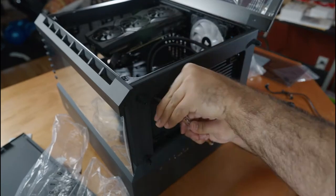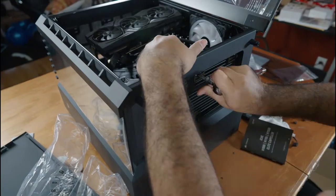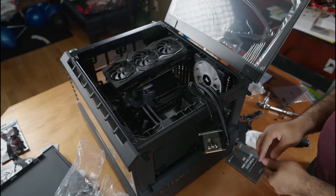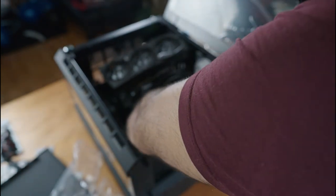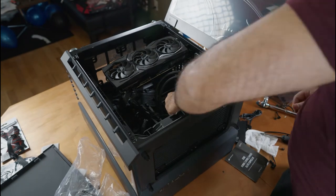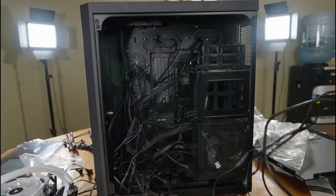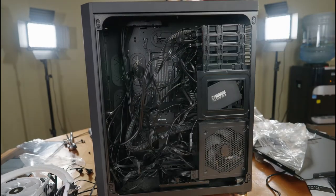Now we have to install the radiator in the case, and as I mentioned, the screws were insanely hard to drive in — it took a lot of time and patience, but we finally got it installed. I held off installing the cooler on the CPU until after the radiator was mounted, so I didn't have to move it around and add more work. Once the radiator was in place, we hooked the cooler onto the motherboard and tightened it with a screwdriver. Finally, we ran the fan and cooler wires to the back of the case and connected them to the lighting module that came with the cooler — which made the Commander Pro unnecessary.